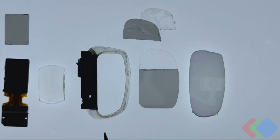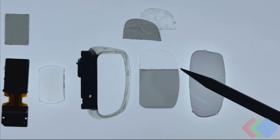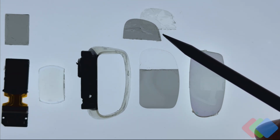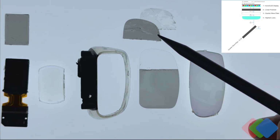But once we've assembled the lens and OLED microdisplay into the housing, we can start looking at the lenses that actually start bouncing light. And so we have our first lens element here. It's a flat lens that goes onto this 45-degree surface. And this is what we refer to as a polarizing beam splitter sometimes, but really we're talking about a very interesting functionality here, which is, you can see I've removed the film from the lens here. On the bottom side here, we still have the film laminated to the lens, but on the top side, we've actually removed the film, which is a two-component film. At the top right, a quarter wave plate, and below it, a reflective polarizer.